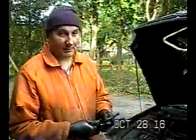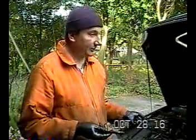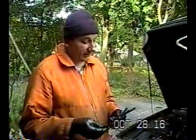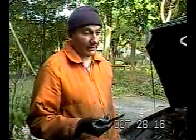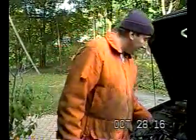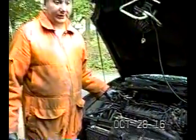I wanted to take the head bolts out without going through the whole rigmarole and see what they look like, because these head bolts are known to have problems. Most people replace them with inserts or studs. But in almost all cases on the internet, you see people say that these either break off or you pull up the aluminum along with it. So I took all 10 head bolts out of this bank to see what they look like, and they all look really good, actually.